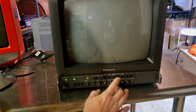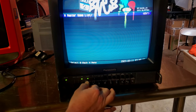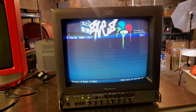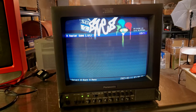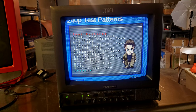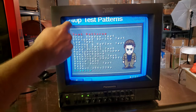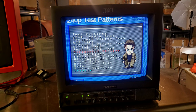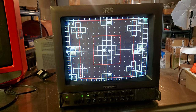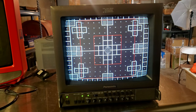Let's figure out what we need to push on the buttons down here. We've got auto and select RGB, and that's pretty much it. I'm going to turn down the contrast and brightness a little bit so it doesn't appear so bright on your screen. Let's just look quickly and make sure that it doesn't look terrible anymore. It's been sitting here for a while. Now you will have more of a curved look on this — it's an extremely curved tube, shadow mask style, with all edges curved. That does appear different compared to the Trinitrons with the flat edge. This one looks pretty good.